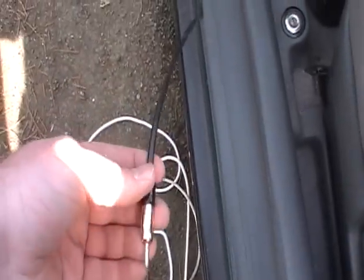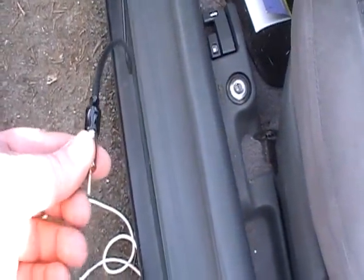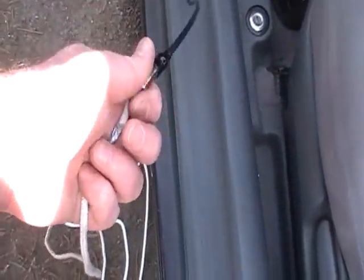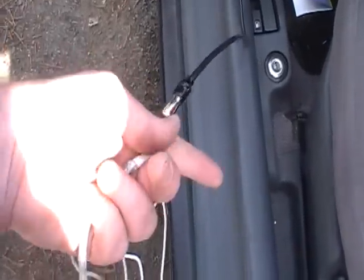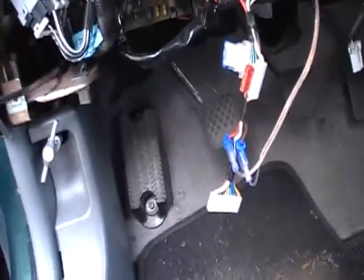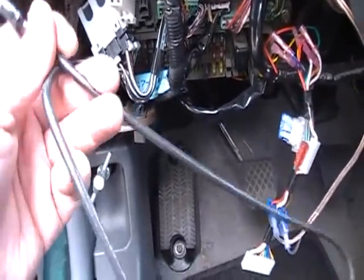With it up here at the side, it made it too thick, and it kind of bound at the end down there. But when I basically put the 2 strings, the string and the antenna lead, if I butted it up right here, again like this, just put it at the tip there and tape it all up, then it pulled through. That gives it a flex right here, and that'll pull through much easier. And so that's about it. All I'm going to do now is plug this back in, and you just coil up your zip tie or whatever your excess and put your panels back on, and you're done.